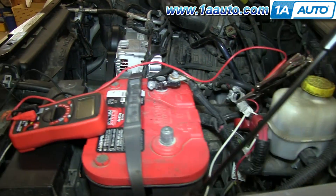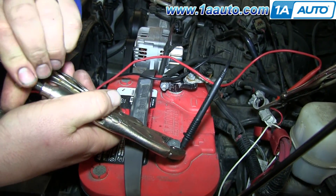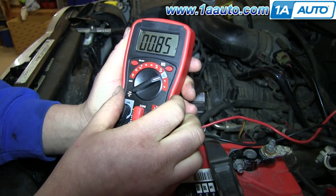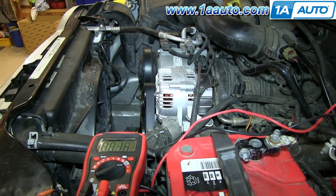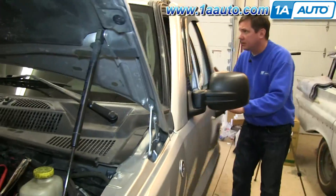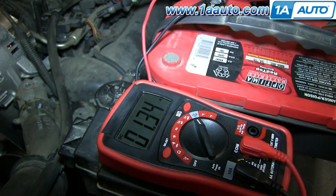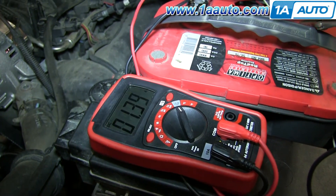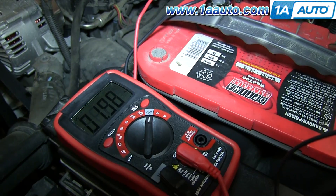I'm going to use my other vice grip and put this on here. Take your multimeter, switch it on, and you're going to see your draw. We've got 0.16 amps of draw at this moment. I'm going to show you what happens when we open a door and a dome light comes on — the draw has gone up to an amp. With two dome lights on, it should have doubled.